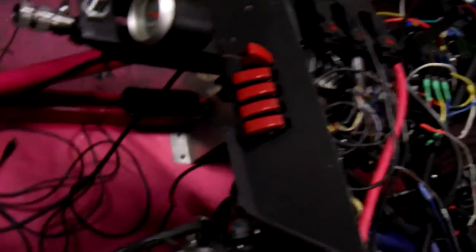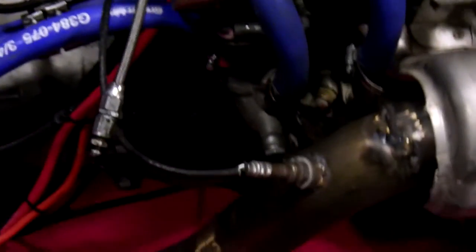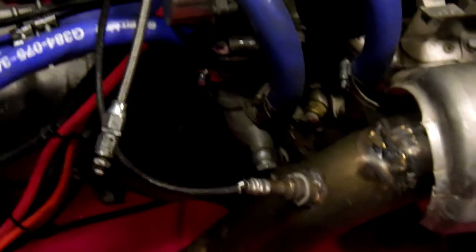You can see that I moved the battery. I had it right in front of the rear wheel — I moved it over to right there. So I got a new battery box and I also ran new cables. I have this really big red one going to the main big on/off switch below the dash. And I have a ground running from the battery to the engine, and another ground running from the battery to the frame.